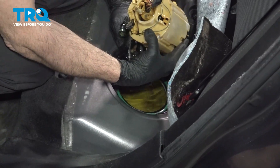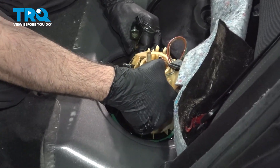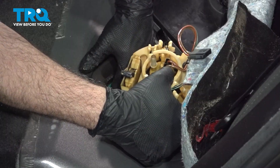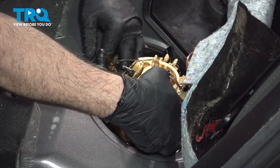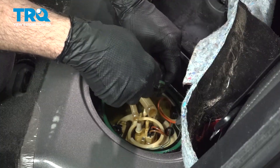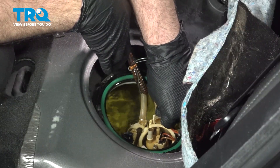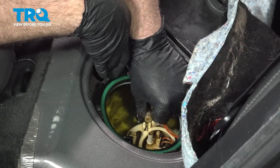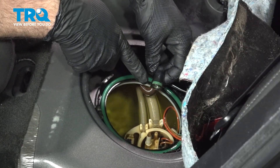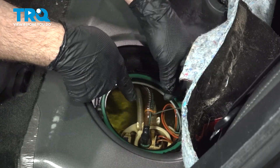What we want to do is lower our fuel pump down in. Make sure that the float itself does not get bent, forced, or damaged on its way in. You can drop that down inside. We have a couple simple connections to do — our flow hoses right here are simply going to clip in to the retainers, so you press those in. There's going to be a fat hose and a skinny hose — press those in. Then we have the fuel line transfer right here — line it up on top of the fuel pump, push that down, and you're going to feel and hear it click into place.